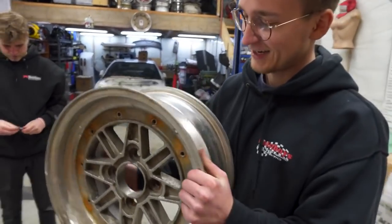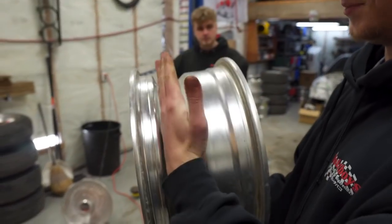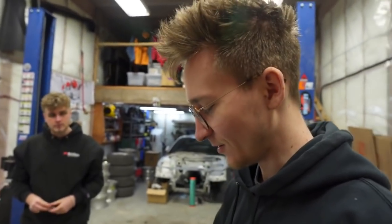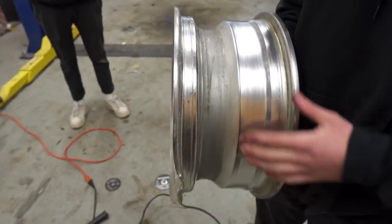Is there a trick to this? Well, last time I did this, I bolted it on the car and then put it in fifth and held a blade right on the weld, so that it went perfectly around. But that took a really long time, and then I was like, why don't I just roll it on the ground? That's gonna run smooth. Once you get a little nook, then it's just smooth sailing. It's like a guide. It's a guide cut.